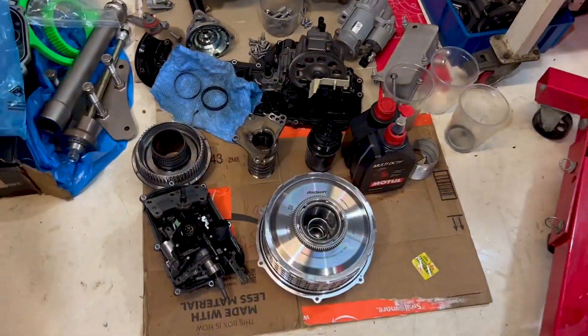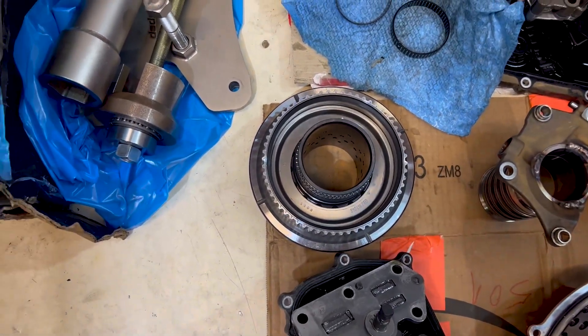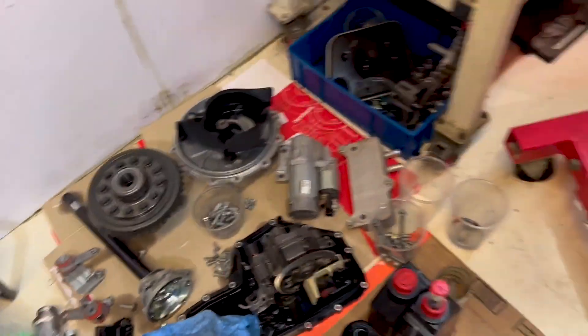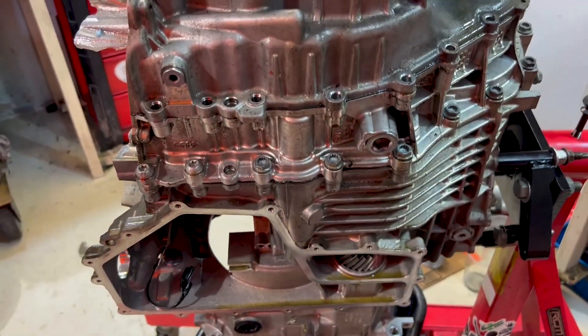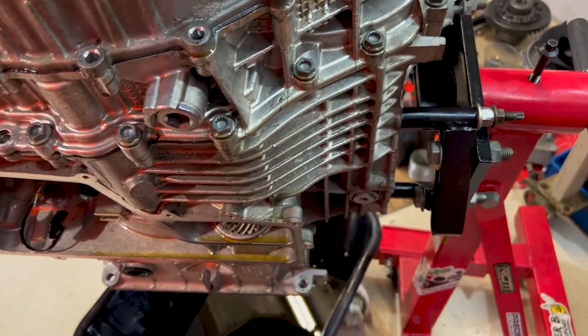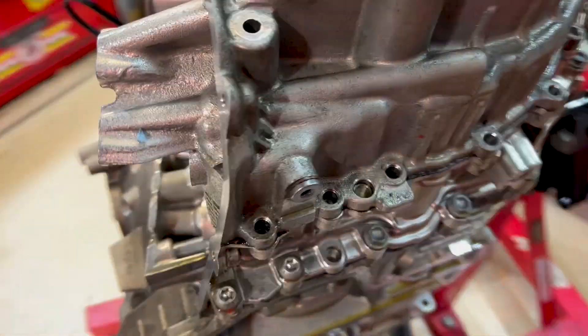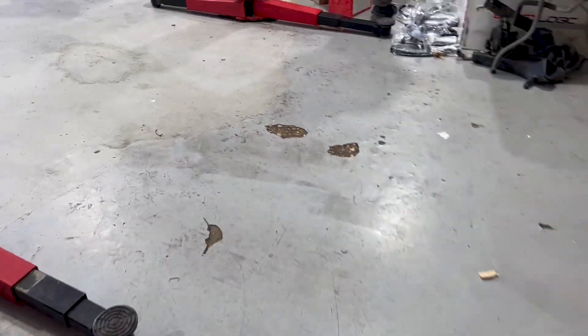I have the clutches built. Everything else is off - there's my modified clutch that we didn't need, the clutch core that we didn't need, and the rest of my tools. Gearbox is stripped - started to be anyway. I'm just about to pull the rear cover off. I've got the seals off the back. I'll get them heated up and get them sorted. Getting my gloves back on and get oily - catch you guys in a bit.